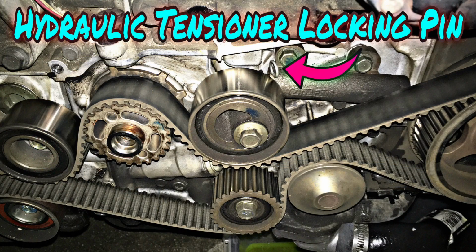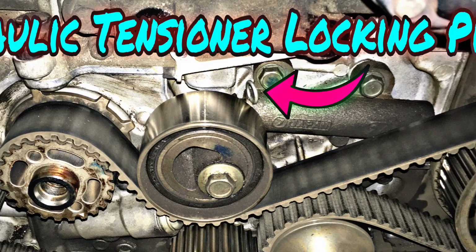These hydraulic tensioners for these Subarus, they actually come locked and compressed with a pin that locks the piston for that hydraulic tensioner in the closed position. And that pin is in there to keep it closed so you can install the hydraulic tensioner and then install the belts and time everything correctly. And then after you've timed everything correctly and you double checked it, you pull that pin out of the tensioner, and then the tensioner expands under that hydraulic pressure, and that keeps a pressure on your timing belt. So that way, as your timing belt wears over time and actually stretches slightly, that tensioner will continue putting pressure on that timing belt, and it'll actually keep the timing belt with the same tension on all your pulleys. It's actually a brilliant design and works great.